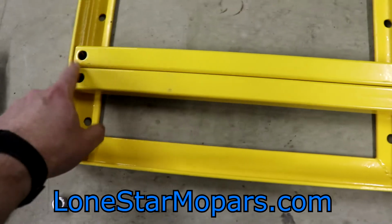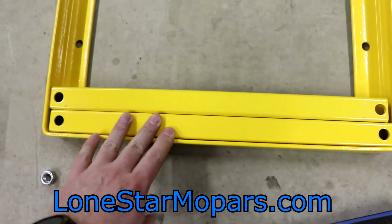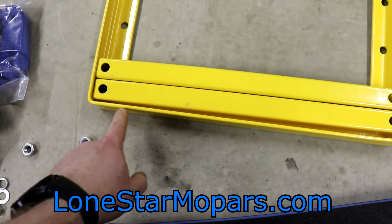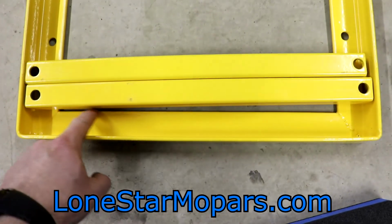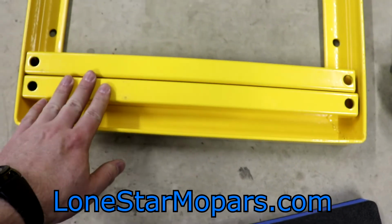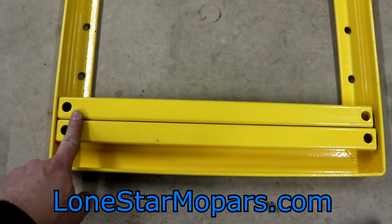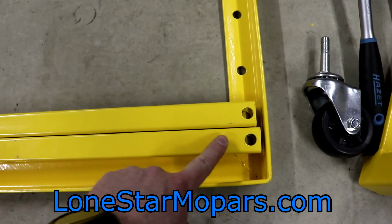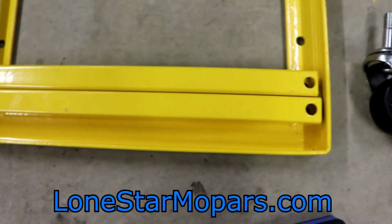So when I have this resting against the side, and in fact, we'll give them every benefit of the doubt and come down into the corner, okay? Not straight in the corner because we'd be cheating them. Let's scoot it back up here and use this line from the angle iron as our guide, okay? Do you see the problem here? Okay, number one, when we have these both butted up against the wall of the angle iron, this one's considerably shorter, okay? Probably about 1/8 of an inch.